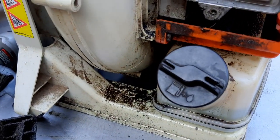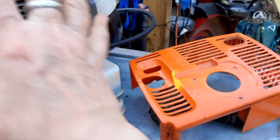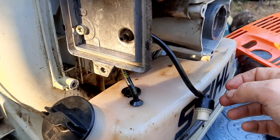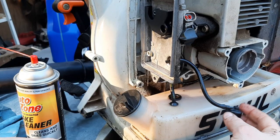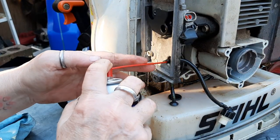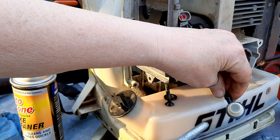I want to show you how I test the tank vent. Very simple. You have to take off the recoil starter and then this cover — these are T27s. The tank vent just pops right off and flows right back into where the carb is. So this might be where the excess pressure was coming out and filling in — maybe he turned it upside down. I cleaned off eight years of debris off the top and hit it with a little brake parts cleaner to get it cleaned up. I can shoot a little bit of air through there and you can see the brake cleaner bubbling out — not real tough, but you want to make sure that's good and clear.